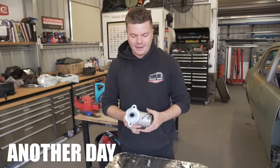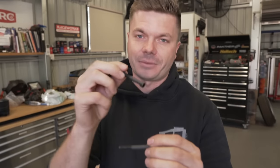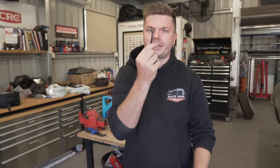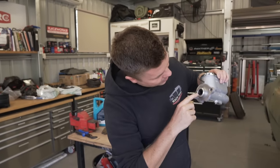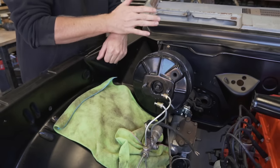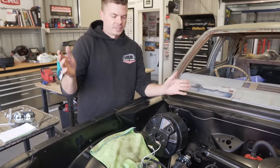It is another day and we have our bolt. We actually bought two bolts. What we're going to do is send these into the master cylinder - these provide the adjustability, which is pretty much how every pushrod works going into a master cylinder. I bought two: one with a hex head and one with an Allen key. In the past we used a hex head - I just rounded it off and made it nice and smooth and it worked okay. This time I'm going with an Allen key because I reckon that might work better, and it actually fits quite well - going to go perfectly in there.